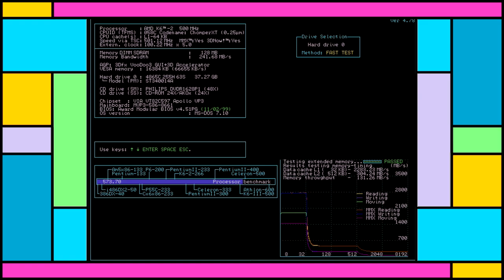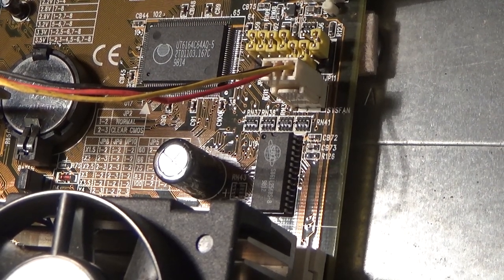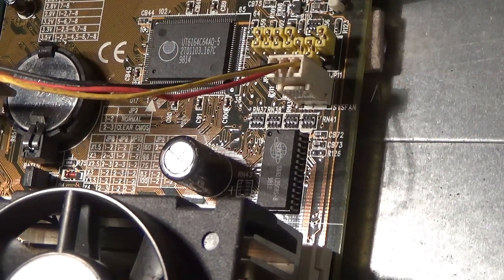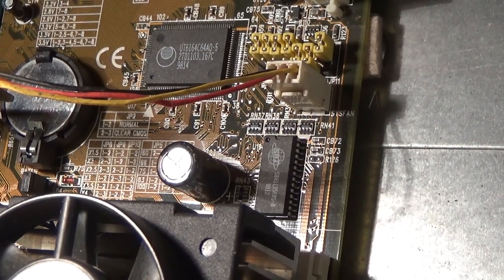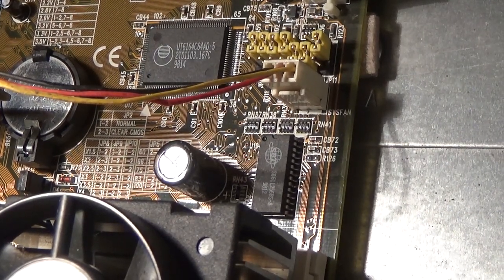We can manage 304.24 for the level 2 cache, which is still external on the K6-2. It's not on the CPU or on the die, anything like that. It's soldered on the motherboard, and this motherboard has 512 kibibytes soldered onto it over there. This varies from board to board, even sometimes with the same model, so if you're looking for a Super 7 board, well, keep an eye on that feature, because you often can't upgrade them this late on. No cache sticks like the earlier ones.